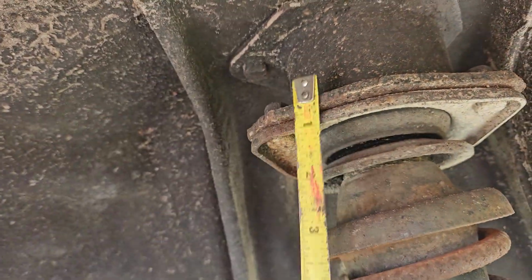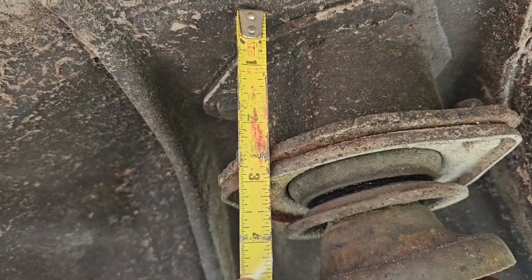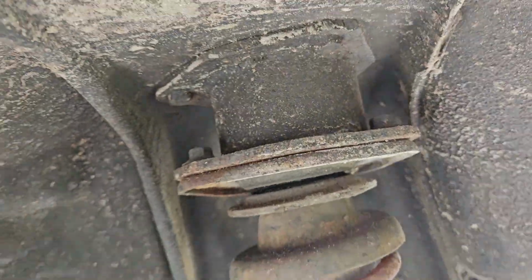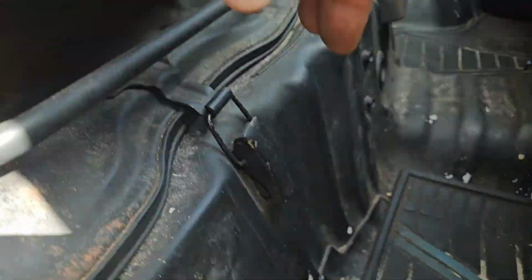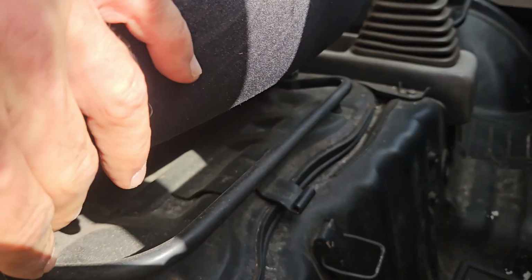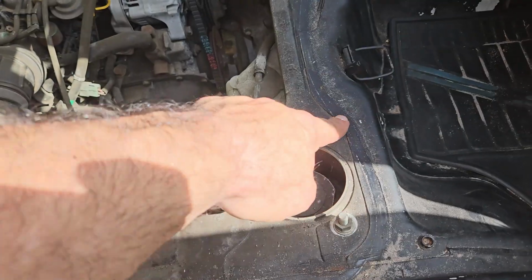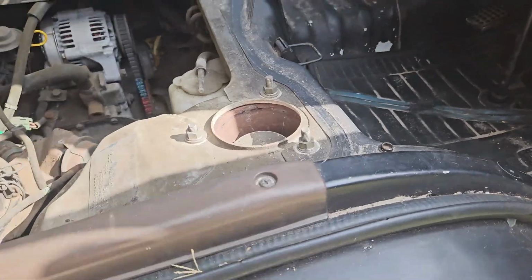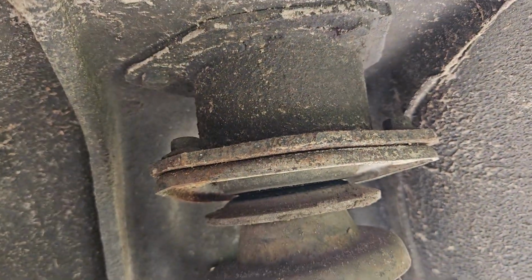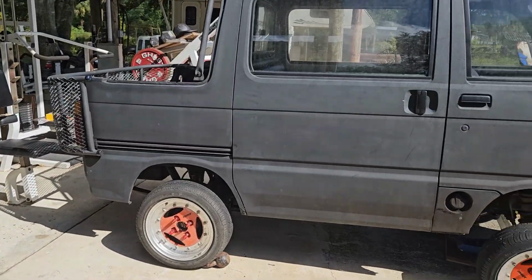So this guy is about, what is that? Just about 3 inches raised up with that guy. And to access the top of it, pretty simple. Pop this little guy out. Now we got access to the engine, but also boom, boom, boom. Drop those 3 bolts. Hopefully just easily remove the little spacer here. Plug the regular one back in. We should be in business for a technically stock ride height deck fan.